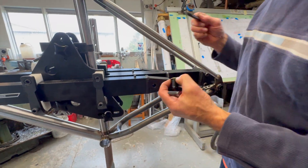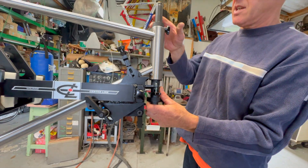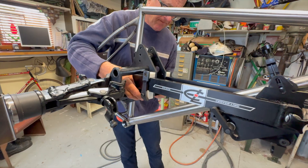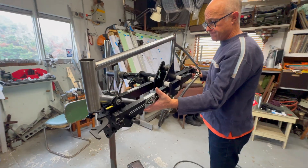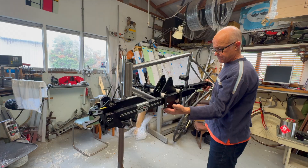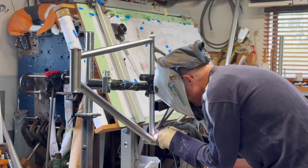Let's remove some fixtures from the rear section — the seat tube and the head tube area. This allows the frame to be withdrawn from the jig as a strong tack-together structure. With my heat sinks in, I use the bike repair stand to fully weld the frame.